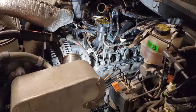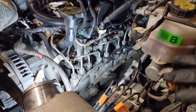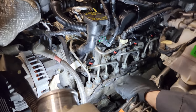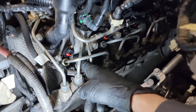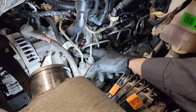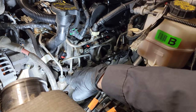I have already gone in and drained the coolant, removed the battery and the degas bottle, got everything folded up out of my way, and I'm trying to get as much clearance to my repair area as I can. We're going to have to remove this fuel injector. There are some risks with removing this injector, and that would be this hold-down bolt — I have had this bolt break off in the cylinder head, requiring a much bigger repair than what I'm actually trying to accomplish.